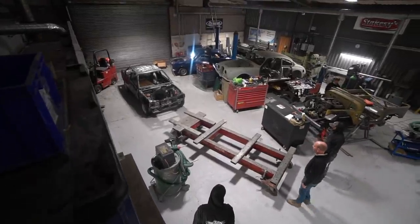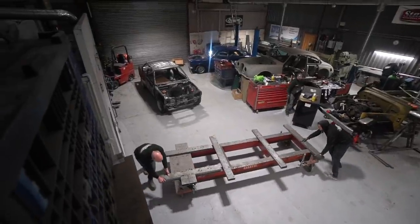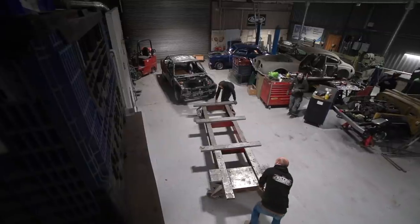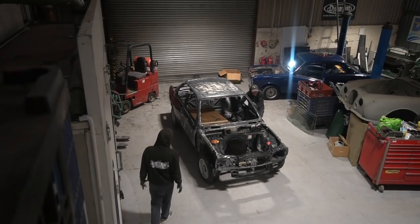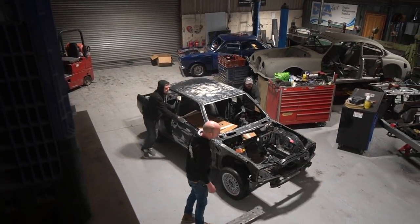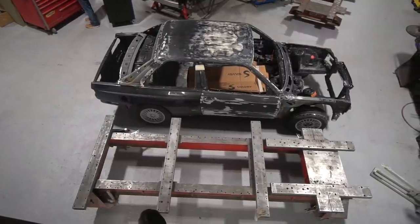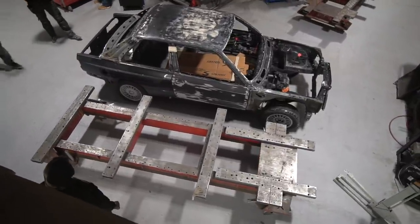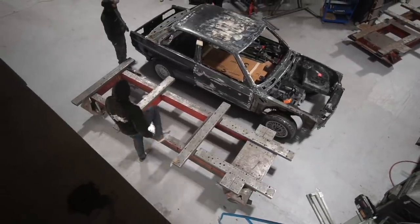We use the Select jig bench, which is here in front of me. That's a type of jig — a frame machine, as Select refer to it. It's basically some large rails that don't bend or move, that you can bolt things onto. Another type is the car aligner type jig — slightly different in the way they work, but basically a big frame that things bolt onto to locate parts of the car.